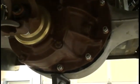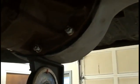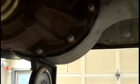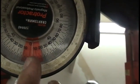The last thing we do when we put a car together using one of these rears, when we get the car completely finished and before we get it ready to drive on the road, is take it to the front end shop. After the front end's aligned, the car should be finished at that point. But before we do that, we get the car set up at the angle we want, then we'll come back and set our pinion angle, which is what we did here, with these bars up top. You bust the jam nuts loose, you turn your adjuster bars left or right, which pivots the housing in or out, which changes the pinion angle.